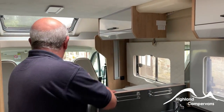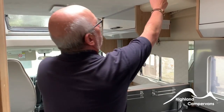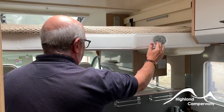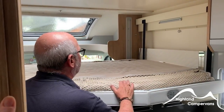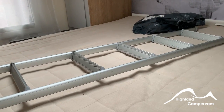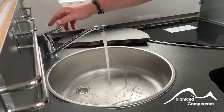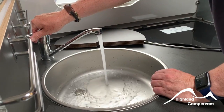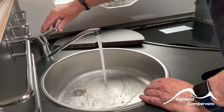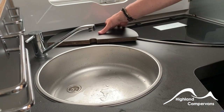In the interior we have five belted seats and the vehicle will comfortably sleep four: two in the double bed in the rear and two in the double bed that drops down above the dinette area. Always look below when bringing it down to make sure you don't foul anything. There's a ladder for accessing the upper bed. To check the boiler is full of water, turn any tap on — if it spurts, there's air in the boiler. Turn to the hot position and when you get continuity of flow, the boiler is charged. It's now safe to switch on central heating and hot water.